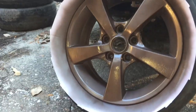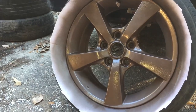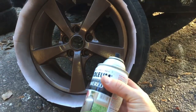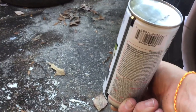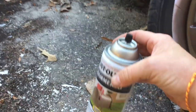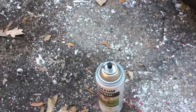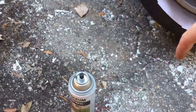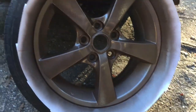I know you can't tell from this video, but this Rust-Oleum Hammered Brown looks more bronze than their bronze does — as far as a dark bronze. Here's a pet peeve of mine: a little spray paint and then put it away — always tip your can upside down and spray it out, away from your project. You will hear the difference in the spray when the line is clear. What it does is the pickup straw is getting air, and that keeps your tip from getting clogged up. My kids know this now, so when they use my spray paint they all spray it out. That's why I hate when people test their spray paints in the store, because you know they're not sprayed out — you're very likely to get somebody's can that they tested and put back on the shelf.